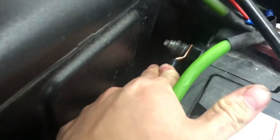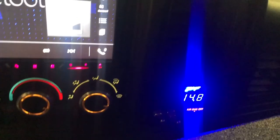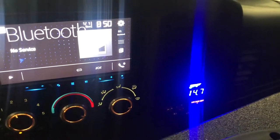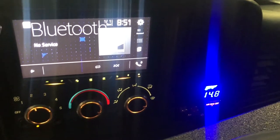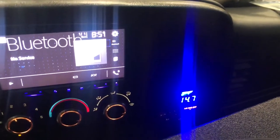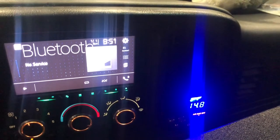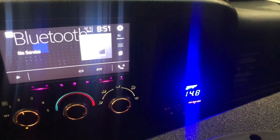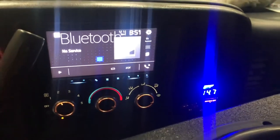I got the green wire cut to length and installed, connected pretty tight. Now we're ready to test the alternator. Our new idle voltage is 14.8, which is a big difference. It did hit 15 volts at one point during a test run off camera. I'm going to re-verify the voltage with a voltmeter off camera, but you can already see the before and after based on these results. The alternator install is done.